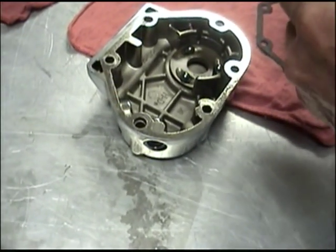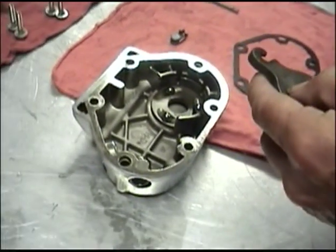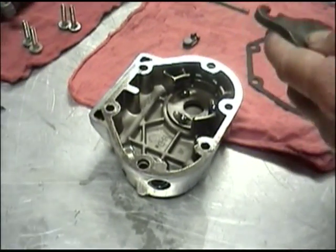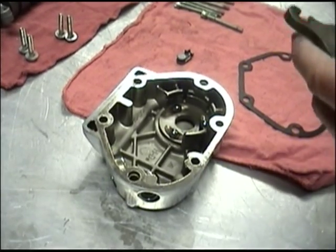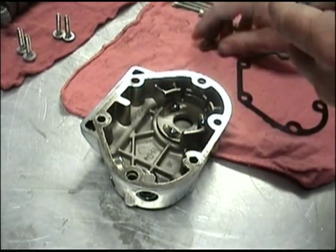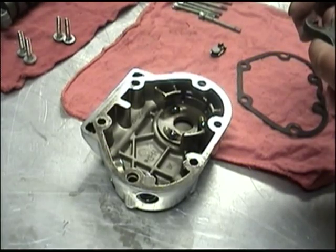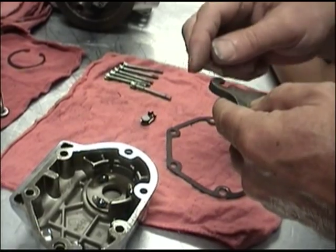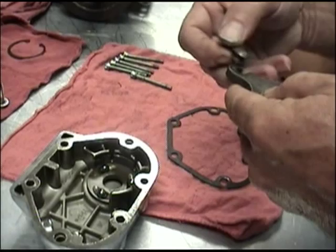Now, we talked yesterday about stiff clutch levers, right? There's a couple of pieces made on the market that will make it easier to pull the clutch lever in. The early stuff was all changing the leverage of this. The White brothers actually made a piece that extended this 1/4 of an inch. Okay? It bolted here, and the lever was out this far, and then this piece was out here.